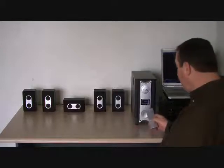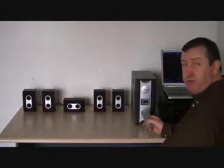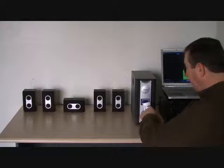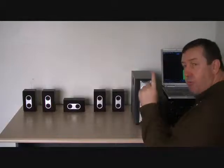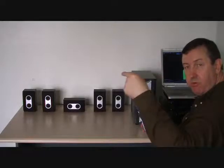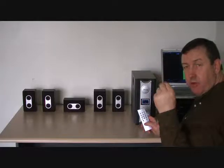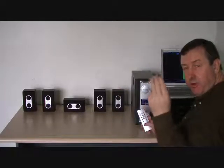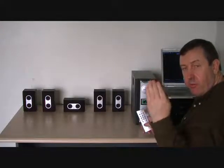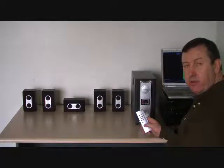We'll begin by pressing the power button, which moves the system from green power saving mode to operating mode. Next, we'll choose our audio source by pressing the stereo button. One time for the player connected to auxiliary 1 on the first row, a second time for the device connected to auxiliary 2 on the second row, a third press for the player connected on the third row. A fourth press cycles us back to the device connected on auxiliary 1.